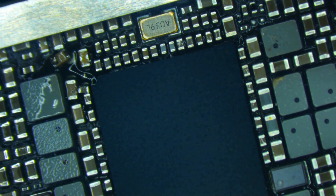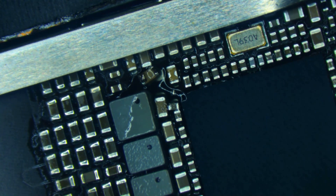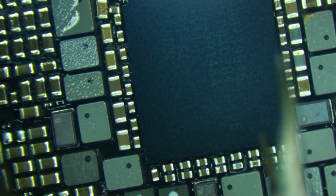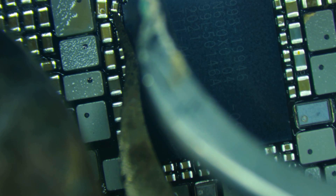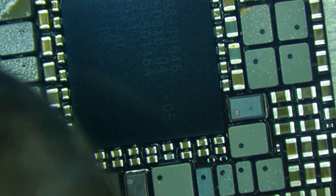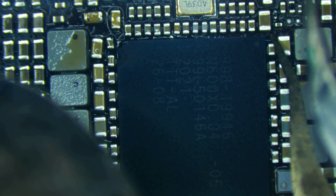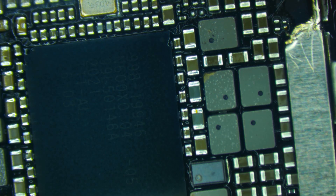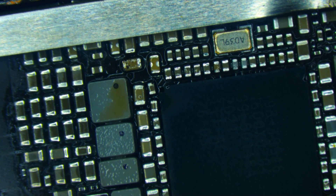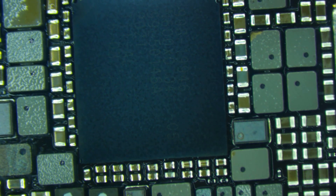The spacing on all sides looks really good. We've got three tasks: solder this IC and move those two caps back into place — going to try to do all of this at the same time. I think the hardest one is going to be the little capacitor. Got those two capacitors back in, and coming in on the side here to give it a little nudge so we know it's sturdy. Let this board cool down — as you can see we accomplished what we needed to: the caps are back in place, nothing else slid out, no bridging, and we snapped the IC in perfectly.